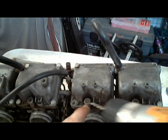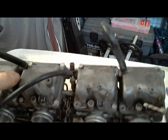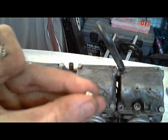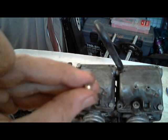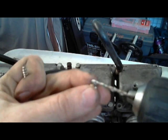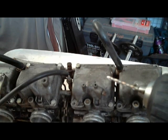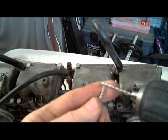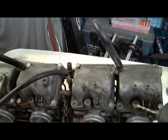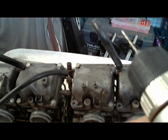I'm not drilling all the way through because, as you can see, it's pretty close to the top of it. You have the screw right here, and the one that I drilled out already is only about 3/16 thick, so it's not very thick. So what you should do is measure up about 3/16 or 1/8 of an inch to be safe, and then put a permanent mark on this side, so you'll know when to stop with the drill bit, so you don't go down too far and damage the head on the screw that we're going to take out.